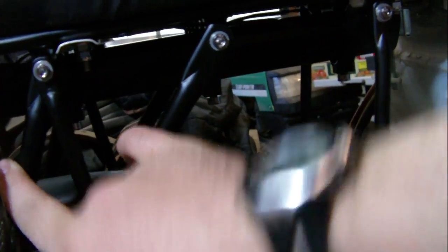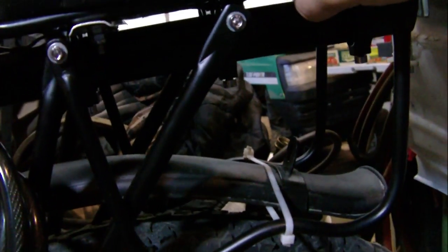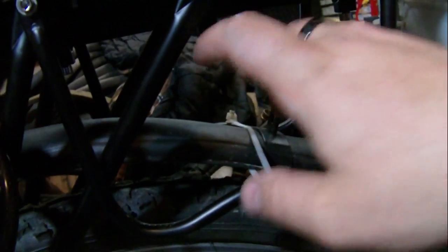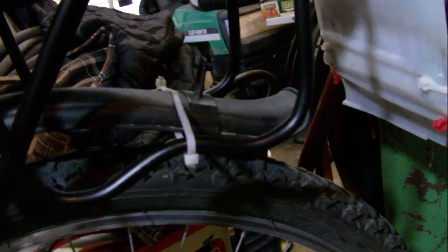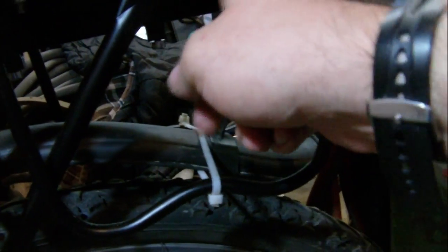Because we've got two support bars now, that means twice as much downward pressure stability and twice as much side-to-side stability — all good news. I've also got three bolts in the rack now whereas before the middle one didn't have a bolt. I've got these brackets for panniers. Right now a zip tie is keeping the fender from moving around, and this other piece keeps the zip tie from moving.